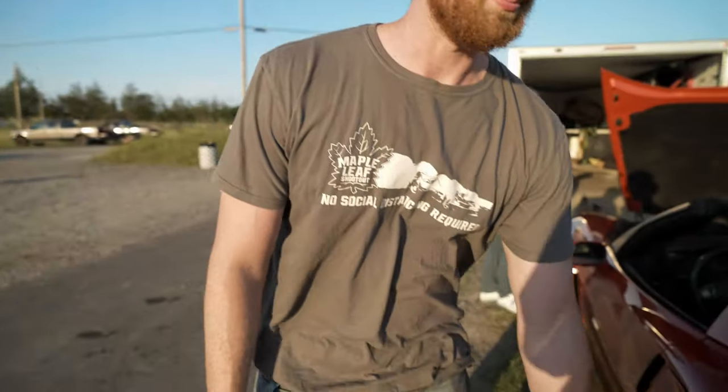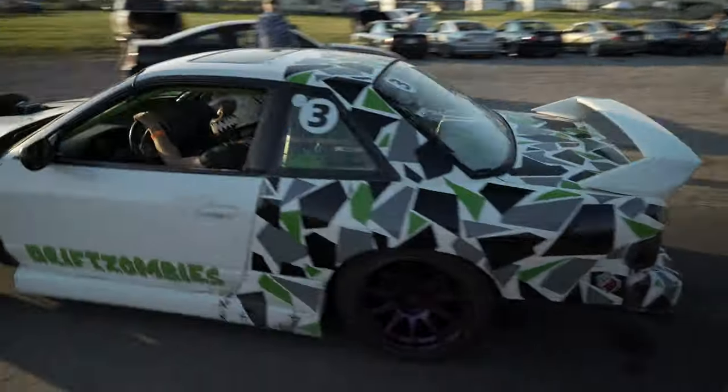We've just done six laps on the Supersports — the Zecnovas — and my direct comparison is that tire life after six laps on each is the exact same tread-depth-wise, but the grip I was getting out of the Valino at 21 PSI was quite a bit more noticeable — a lot more grip with the Valino: side bite, forward bite, everything. I was told that the Zecnovas were smoking more, which makes sense because if the tire is gripping more it's spinning less, so the Zecnovas get a higher surface temperature and smoke more. The Valinos are taking this one.